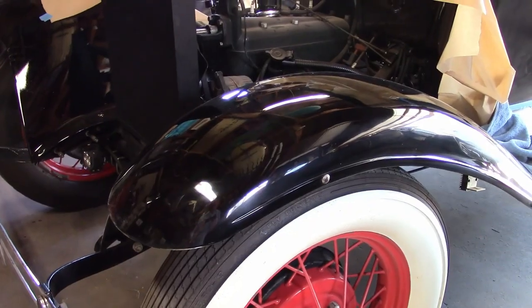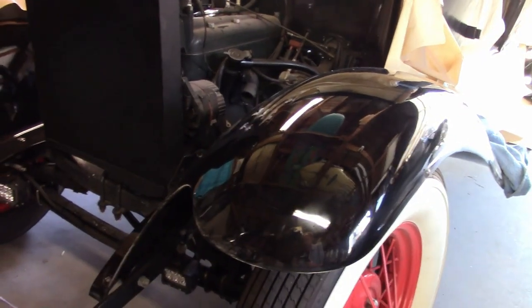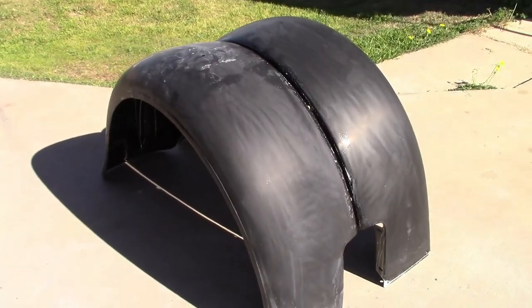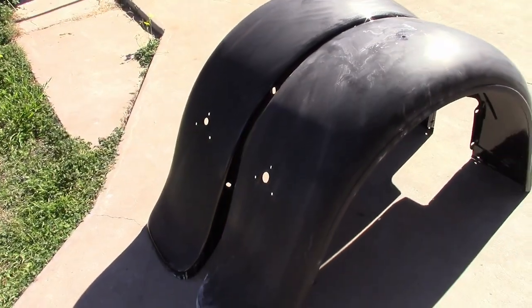So normally what we do with these cars is divide them into two sections. The fenders and aprons are one section, and the body and the hood are another section. With this car, when it was time to start repainting it, we completely ignored the body and the hood and just went after the fenders and aprons until they were done — which we did, and now we're working on the body. The front fenders are finished and are just setting in place right now. The rear fenders have been painted and sanded in 2000 grit, ready to be buffed.